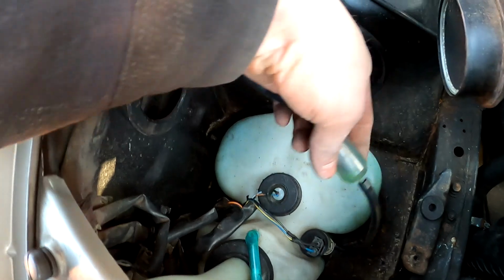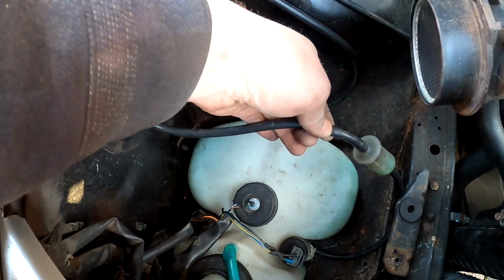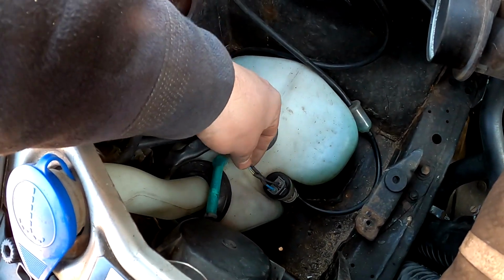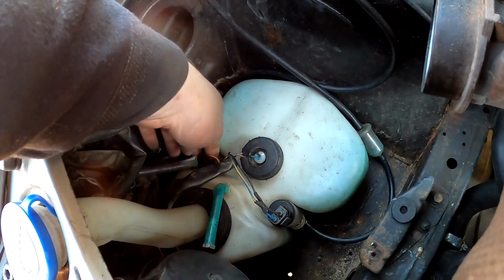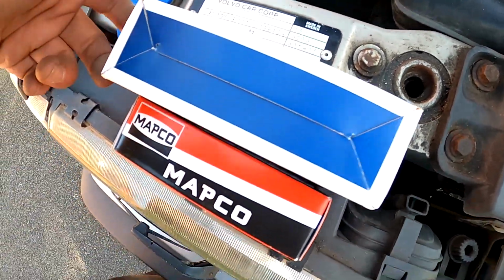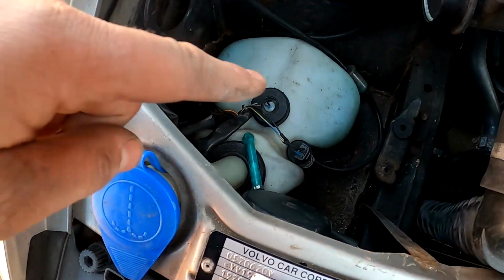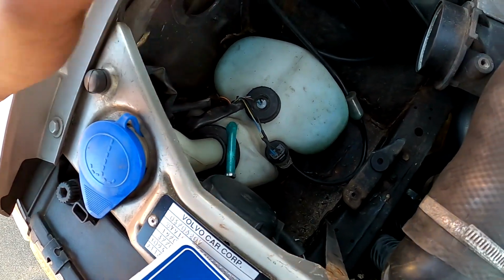Could be different. A Volvo filter, that's all been cleaned out, and you can see there's water flow through it. There's water in the system there. It all seems absolutely fine. It's a bit annoying that it's doing this, but when I ran the pumps, they're just really weak. Like they're not doing anything. So what we're going to do is just pull these pumps out and swap them out. These both came from abroad as well, so I believe this is not a bad brand. So we've got one front and rear, so let's get these opened up, and I'm just going to pop them out and swap them. There's fluid in here, so we should have enough to test with, and then we'll go from there.